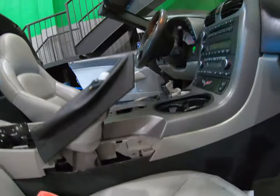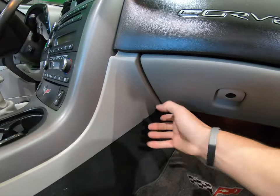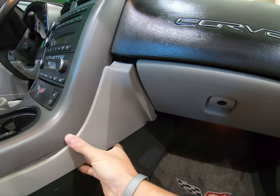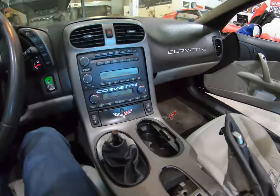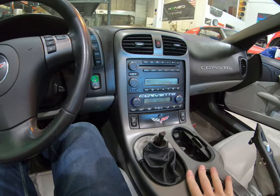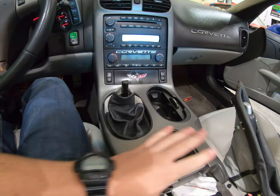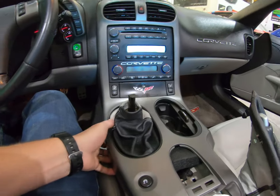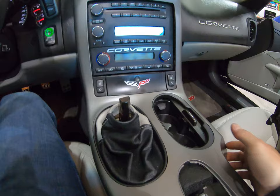I came around the other side of the car. Now that you have these two 7s out, you're going to pop this whole panel out. There's two snap clips up there, so you're just going to grab it, give it a good yank, work it out, and there you go. Now that you've got that side panel out, over on the passenger side, we're actually going to snap everything loose. Gently work your way around. Start from down here, both sides — there's just snap clips that run up and around. Work your way up, go up and around, and do the other side.